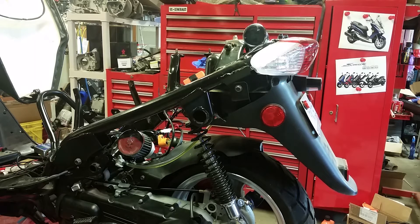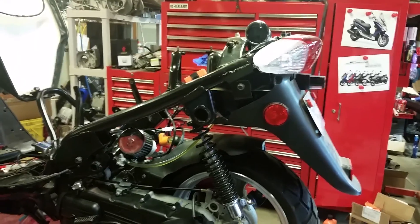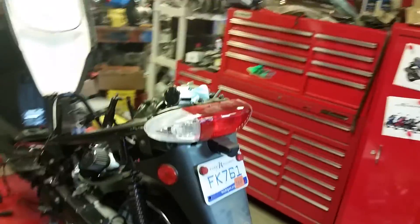So that's fun — this is the fourth time I've pulled this carb. That's what it means to jet a carburetor: you have to take the thing off, put jets in continuously, and do it until you get the right air-fuel mixture. I have found it really hard to do if you don't have an oxygen sensor. I know some guys can tell just by the smell of what's coming out of the exhaust whether you're rich or lean.